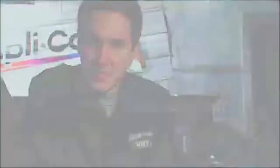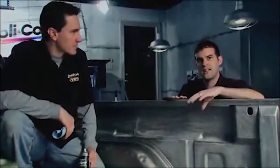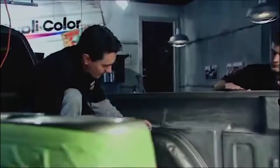When sanding down the bed it creates a lot of dust, so what you can do is hose it out, blow it out with an air line, and then shoot it with some DupliColor prep spray to get rid of any fine residue that's left over. Once you've cleaned and degreased it and that's dry, we're on to application. We've got the bed completely scuffed, taped off, and degreased — the next step is application.